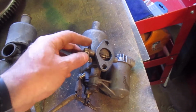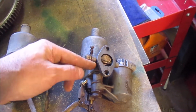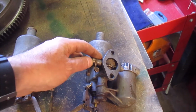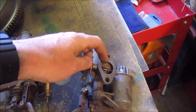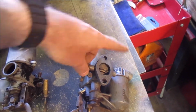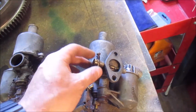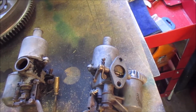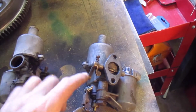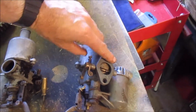And what you can do is you get what's called a chucking reamer, and you effectively run it backwards. So you need a chucking reamer that's got the right size diameter on the cutting flutes for the hole for the bush you're putting in, and on the shank it has to be the same diameter as the existing bush, so it sort of acts like a pilot. Now I don't know if I can find one of those for these, because these are a smaller shaft. These are a 1/4 inch shaft. So what I am thinking I may be able to do is, once I strip all these down, I might be able to make some sort of jig that goes in the mill.